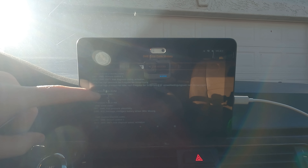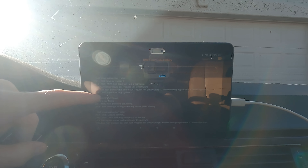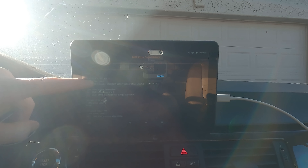I was having a couple of different check engine lights related to high pressure fuel — codes 2FCA and 2FDA were both active, along with another 129F1 and another 2FCA. This confirms the fuel pump was going bad — looks like it had been going bad since November. Overall, this is not a hard fix but it is an expensive one. Luckily, buying through FCP Euro I had a lifetime warranty on it, so I'd definitely recommend FCP Euro or finding somewhere with a lifetime warranty.